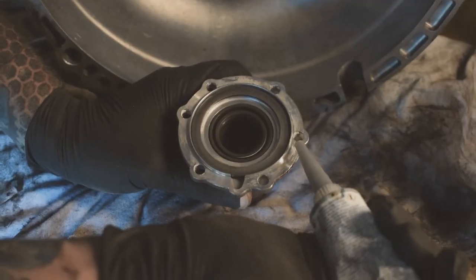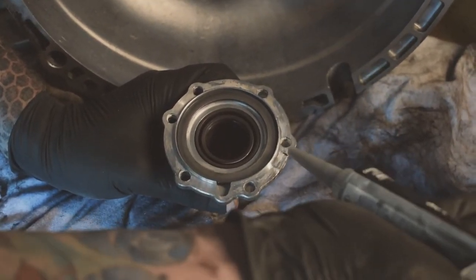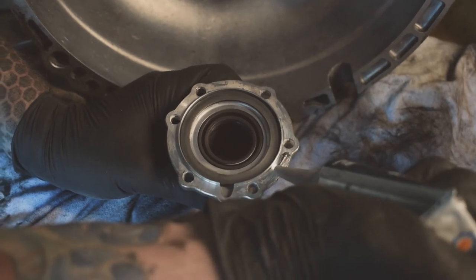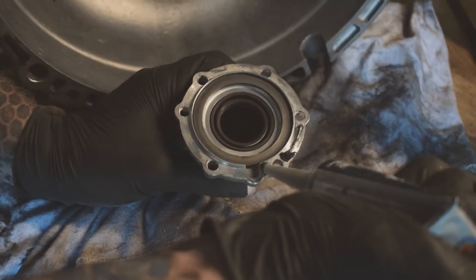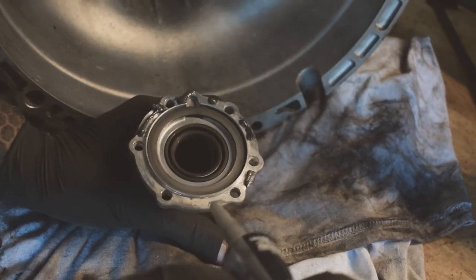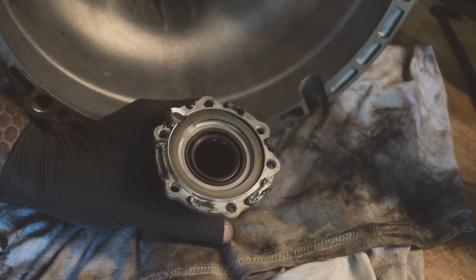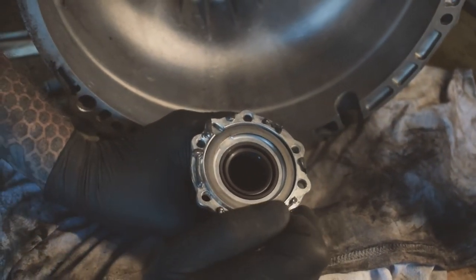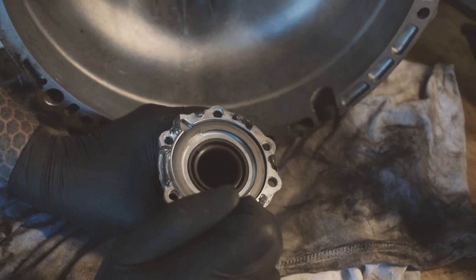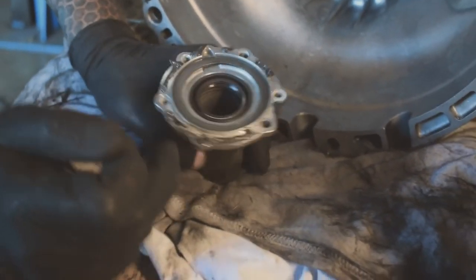Right, so gasket sealer. So the best way to do this is to put some on, make sure you don't put it where you don't want it, and what we normally do is make sure you put some on there, but don't go mad with it. A few dots around. And then rather than just putting it straight on like that, you smudge it with your fingers and sort of pre-spread it around so it won't all go everywhere.